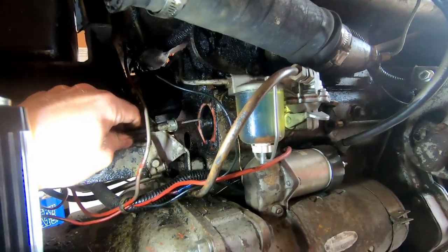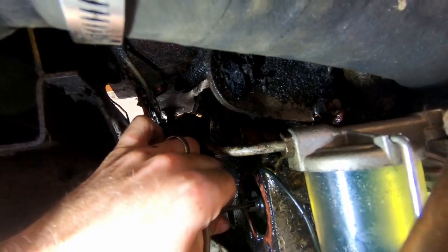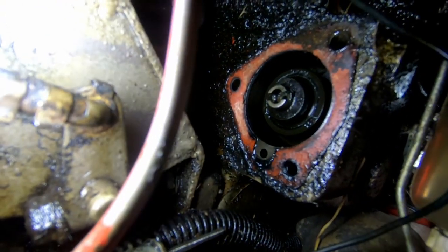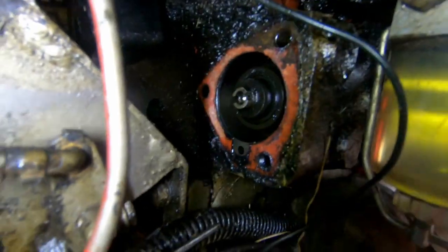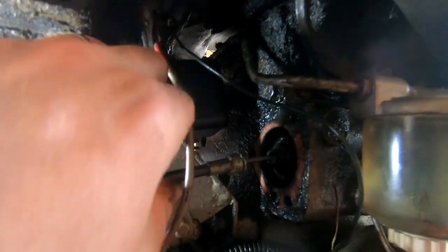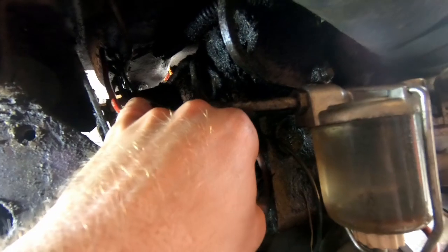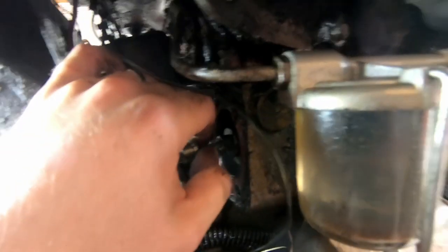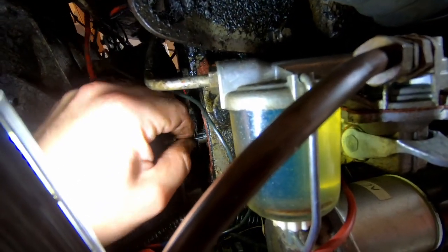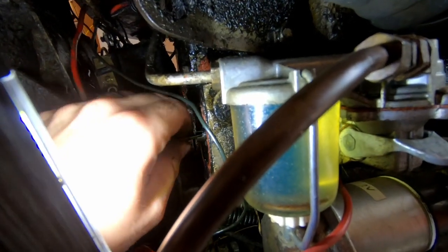Or you could replace it if it's just completely loose and Loctite's not going to do the job. Let's go ahead and put the cable in it. I'm wondering if perhaps the inside of it is rounded out — it's a little hard to tell. Let's put the cable back inside that drive. I'm just going to stick it in there as far as it goes and then try to turn this cable. And that's our problem. If you notice, I am turning the cable freely inside there. So that means somehow or another the end of this tachometer drive adapter got stripped out.